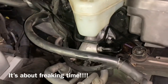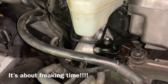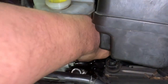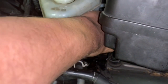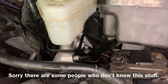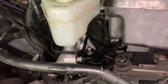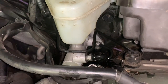Jeff is now going to push down on the brake pedal and fluid should come out. Once he gets to the end, we're going to go ahead and tighten the brake lines back up while he holds the pedal down — I can't stress this enough. Once we get the lines tightened back up, he's going to release the brake pedal. Hopefully that drags fluid and air back up into the master cylinder so we can bleed it on the next cycle. Now we're going to redo the process, and we can see the air come out of the brake line and the master cylinder. We're going to re-tighten our lines and repeat this several times until the air dissipates.